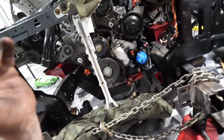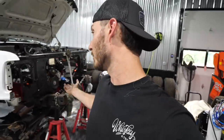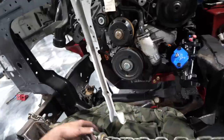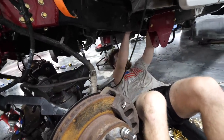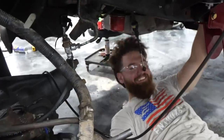We had to make a small notch out to get the track bar bracket to fit up in here — we used two pre-existing holes that were on the frame rail. A lot of guessing was done in order to get this motor in here: we wanted to maintain a factory angle and factory mounting style in the event that we pull the motor out in the future. It worked out really well because it laterally lined up with the front of the crossmember — couldn't work any better. Now we have the ability to actually bolt up the track bar to the track bar bracket once the boys finish up the radius arm drop brackets.